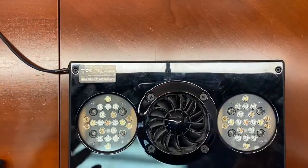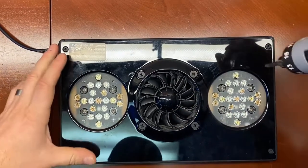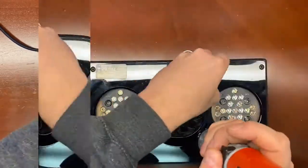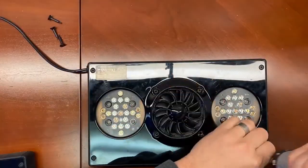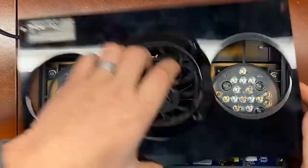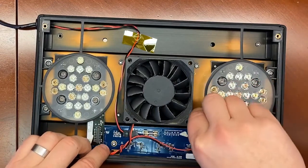Very simple. Easier to do if the cord is away from you — there's a tip from service. Then you simply remove these four screws. Once you have these four screws removed, you can remove the base plate. There is your green RF module.